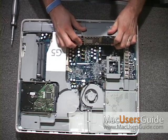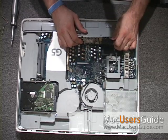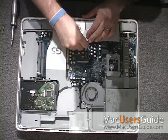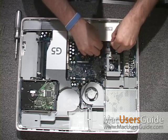Now you're ready to reinstall the power supply. You want to make sure you lever it in, push the side that's closest to you towards you, and then push down. That'll reseat it. Then, return all the screws back into their original holes, and then reseat the cable connector back to the motherboard.